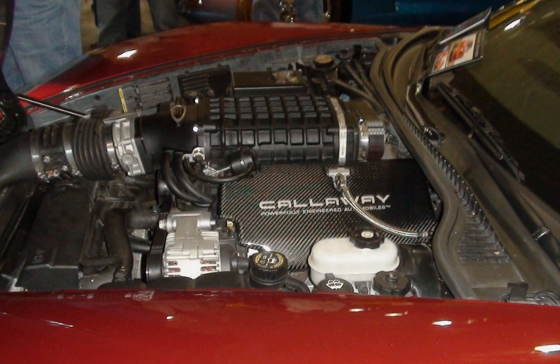The first of the Generation IIIs, the LS-1 was the progenitor of the new architecture design that would transform the entire V8 line and influence the last of the big blocks. The Generation III 5.7L shares little other than similar displacement, external dimensions, and rod bearings with its predecessor, the LT-1.